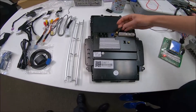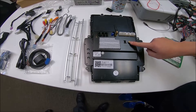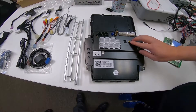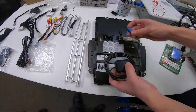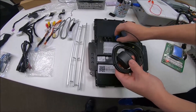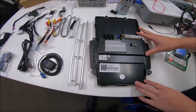You have a Wi-Fi antenna here that we already screwed on. You have the factory RCA jack for the factory backup camera to retain. If you have a 360 camera on your Q50 or Q60, that is also retained to hook up through here. You have the GPS antenna — in the box you'll get a GPS antenna that you connect here. Route it anywhere inside or outside the car as long as you have green bars on the GPS monitor area.